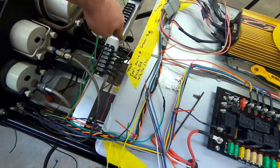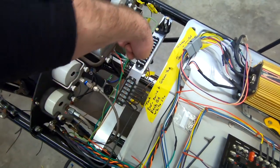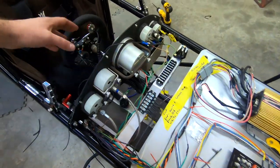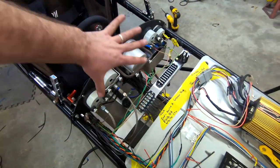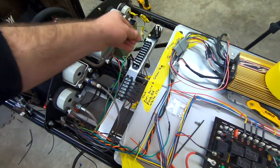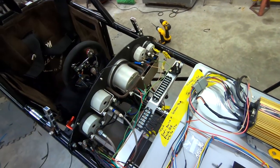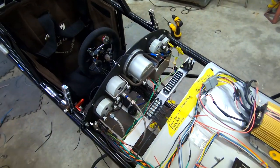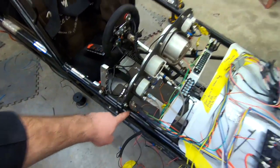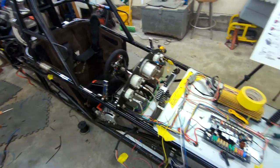We incorporated this kind of bridge piece of aluminum into the car so we could have a couple terminal strips mounted in here. So then all of our gauge lighting, and our button switches and stuff that kind of needs to come from up here. Can have a nice loom here, and we'll swing some connectors through these terminals and then out the other side to the delay box or to wherever they're going. We're bringing power up here, and we got ground going on right here. So like I said, it's kind of hard to see what's going on right now, but it's going.